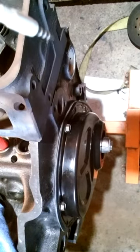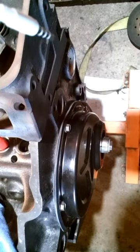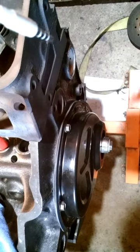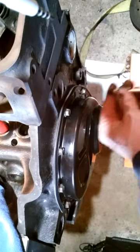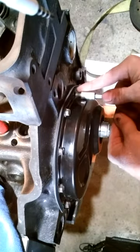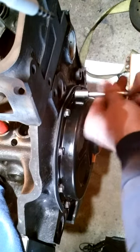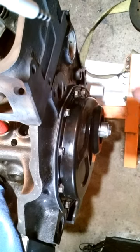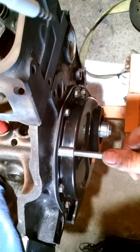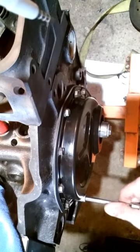Roller cams are more of an advantage. Let me pause while I put all the bolts on and we'll see how our gap is. The camshaft is pushed all the way back so this is going to push against the cam. We're putting the cam button and timing cover on, torquing these to just hand tight — six foot pounds is what my manual says. You tighten them by hand with one hand because you don't want to bend the cover.